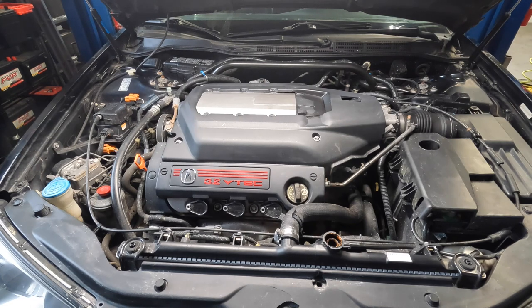I'm going to drain the cooling system — I'll show you how to do that so you can see how disgusting it is. After that, we'll fill it up with water, add our solution, and run the car for about six hours. After that we'll let it cool down, flush it out again to get all that nasty stuff out, then fill it up with more water and more cleaner and repeat the cycle. Let me get this car up in the air and start draining the system.